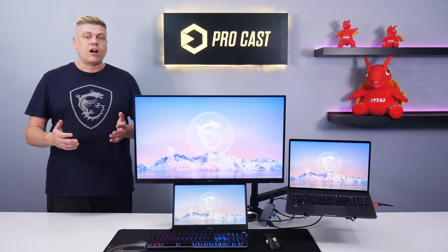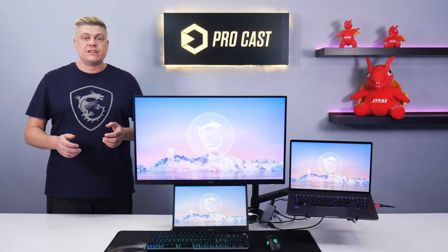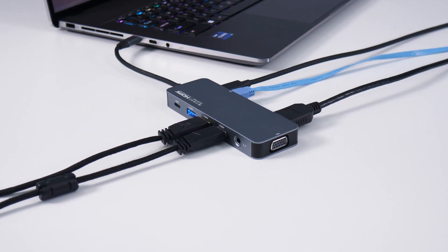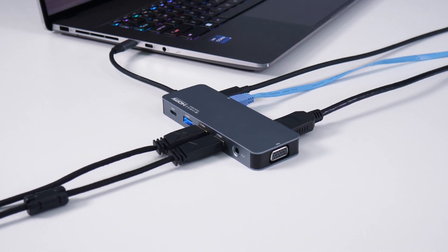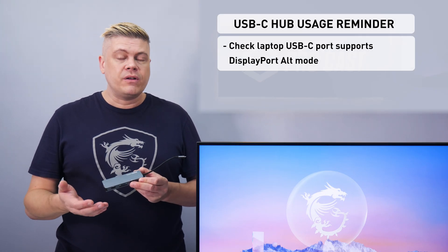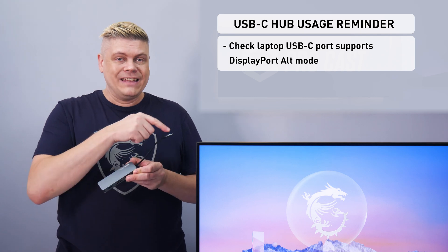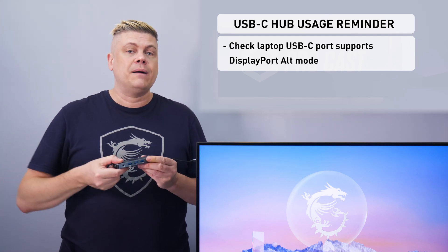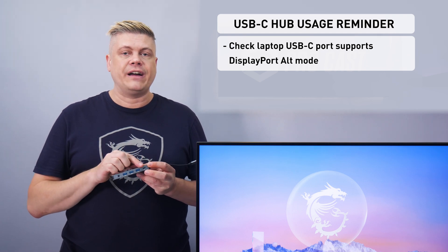Getting the correct support hardware is challenging, so we'll go over some tips and common issues. The key piece is the USB-C hub and what it can and can't do. The laptop's USB-C port must have DisplayPort alt mode so video flows out into and through the hub, and out the hub's HDMI or DisplayPort. Note that hubs don't support USB-C video out unless specified.